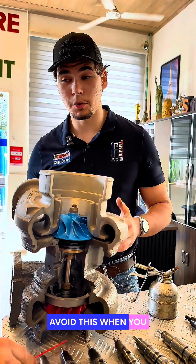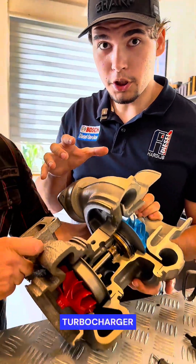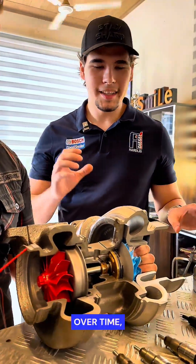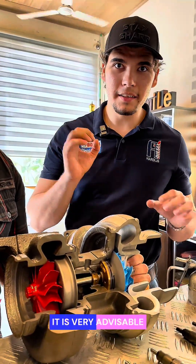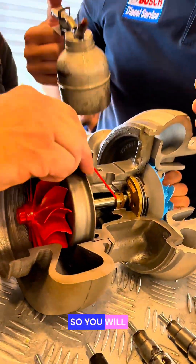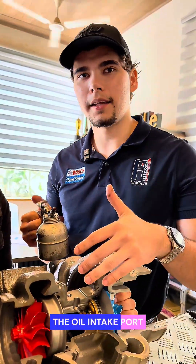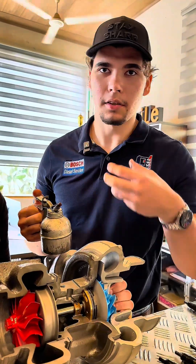So how do you avoid this when you install a new turbocharger? When the factory does balancing on your turbocharger cartridge they will add oil, but over time if it's sitting in a warehouse that oil will spread around inside the turbo. On the first start, it is very advisable that the full shaft and the bearings are nicely covered in oil to create an oil pillow. So you typically take a syringe, insert it into the oil intake port, and squeeze oil inside so that everything is nicely covered before your first spark.